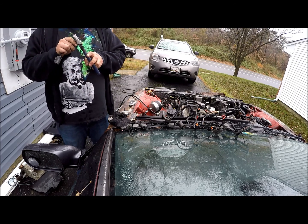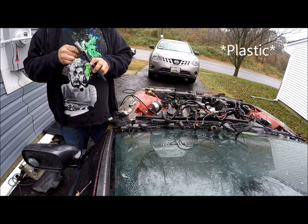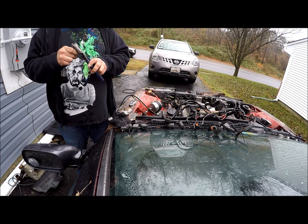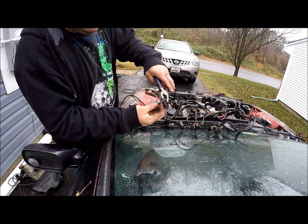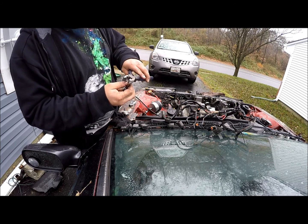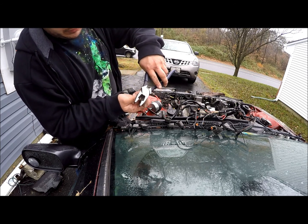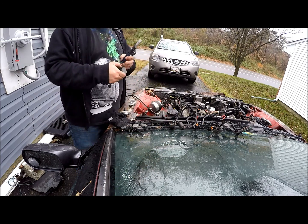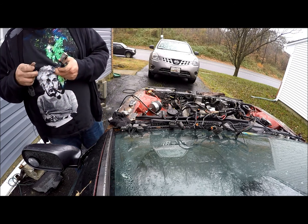The key is basically to not cut, but you want to stretch that rubber off. So you just kind of indent it, and then you stretch the rubber off, and it'll snap right where you indented. This also helps because I use this depth of my Klein's as the guide for how much I'm stripping off. As you can see, that wire is right at the top of those Klein's, so that gives me the perfect amount so that I have enough to solder, and also so that my shrink wrap fits.